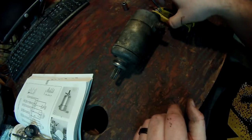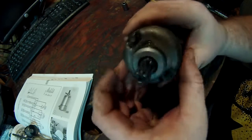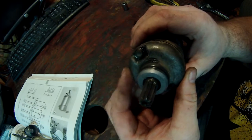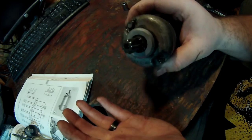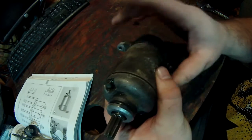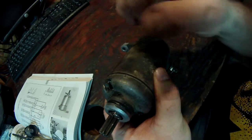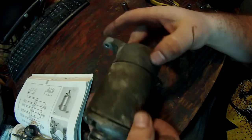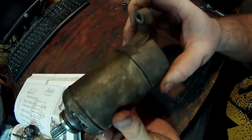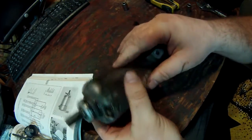I got the starter off. I didn't realize there was so much oil sitting up in the top like that - maybe it's because I had the bike leaned over. It did say to have it on a level surface, but I didn't see a super need for that considering I was going to be working on the side of the bike that it unbolts from. But anyway, I'm going to have to put probably a quart or so of oil back in the bike.